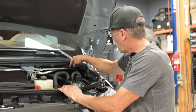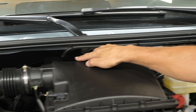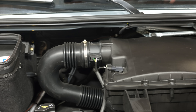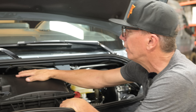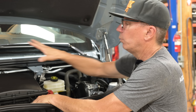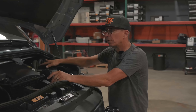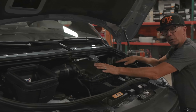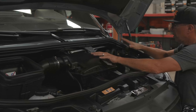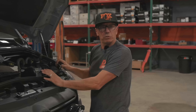Another key feature is we added a heat exchanger — we tie into the engine over here. Coming out of the firewall there's the heater core underneath. We tie in there and also add a little pump. That pump allows us to recirculate when the engine's not running. The benefit is we can run the furnace and heat the engine while the engine's not running, or we can heat the house with the engine while the furnace isn't running. It works super, super slick.